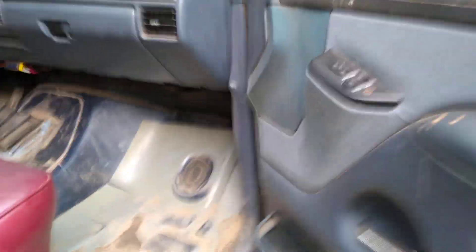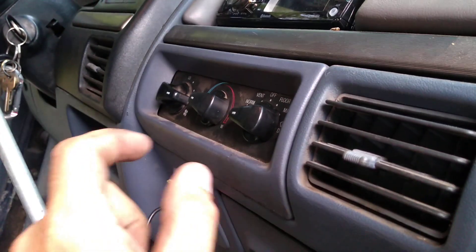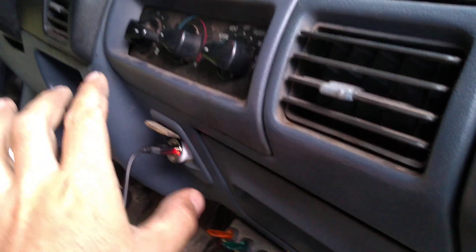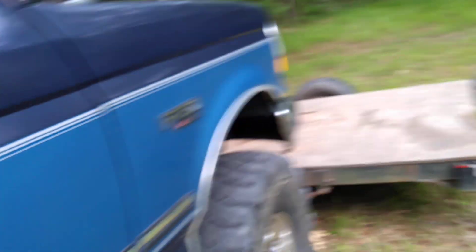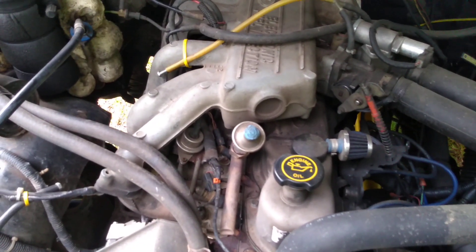As for how I did this blue line — if I remember correctly, I took this off and behind there there's a bunch of plugs. I found a little piece of clear tubing and made a little junction, running it around to that. I did one line at a time because it's really confusing if you do it all together. When I got the truck there was nothing there, and when I got this engine out of the other truck, half the vacuum lines weren't even there because it had sat in a field for five, six, seven years.